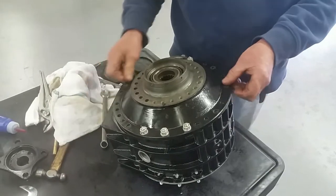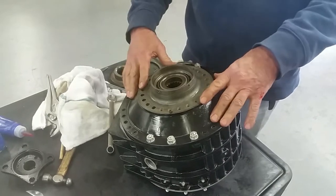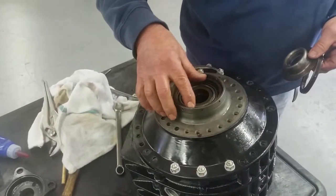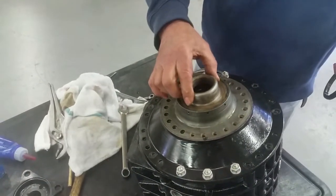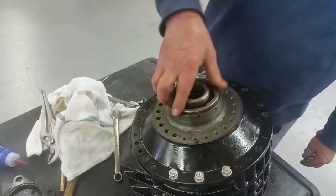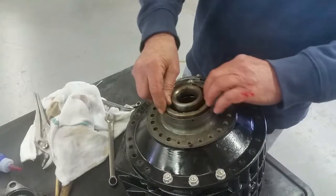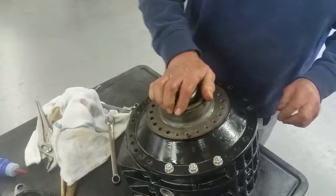For our final measurement, we're obviously going to have a whole bunch more bolts in so that we're sure that everything is square and down. So the next thing we're going to do is we're going to put our spacer in. This is the spacer that pushes on the bearing, that gives you your backlash. This again is a left-hand thread, sometimes known as a wrong-hand thread. So you screw it in, you unscrew it in, as they say. All these smart remarks. Anyway, that's that.